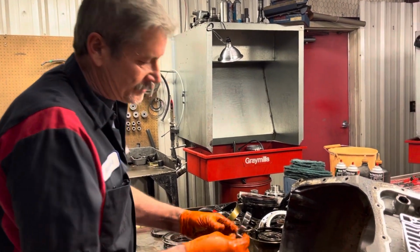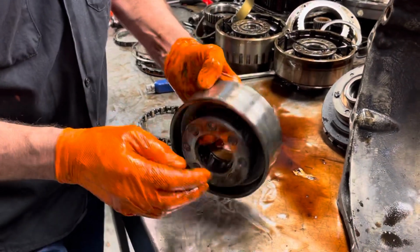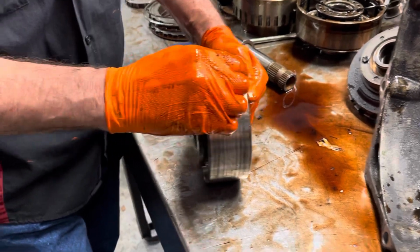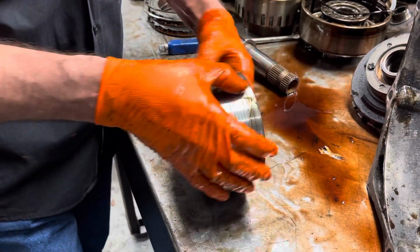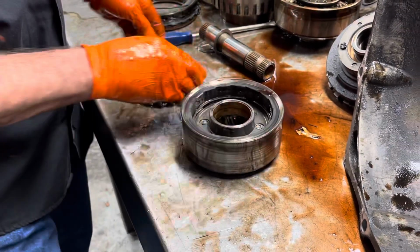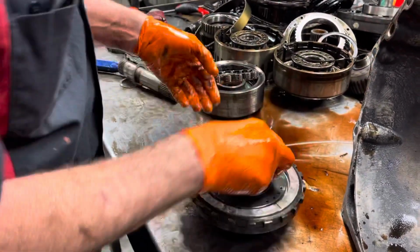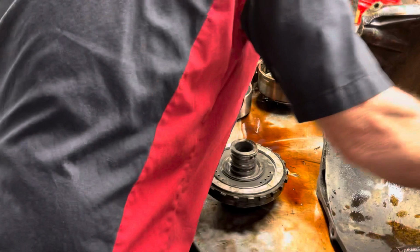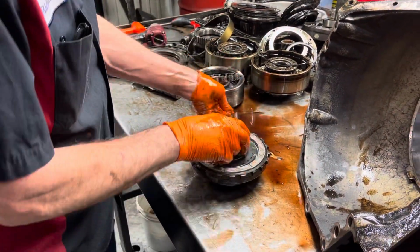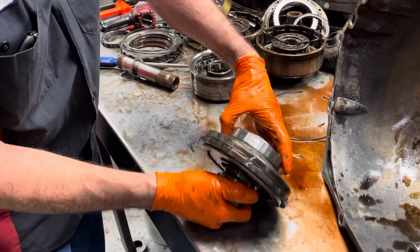And we have a roller clutch here. Now we do have quite a bit of band wear here. These are some really big ridges through here. I mean, the drum will have to be replaced. So, got our center support. We do have our little thin snap ring in the case that sets under the support. Sprag inner race looks really nice.